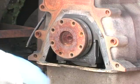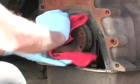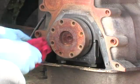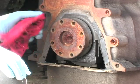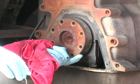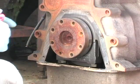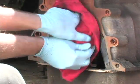First thing we're going to do is we're going to wipe off our crankshaft, and we're going to see how bad the damage is. And I see a few pits out here in the outer edges, but basically back here where the seal rubs, it looks like it's in pretty good shape, so we really don't have much to worry about there.